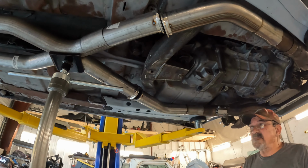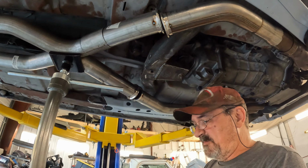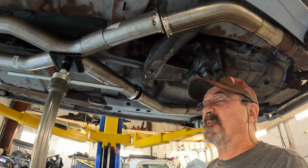All right, let's go ahead and give this a try. The one thing about a V-band clamp is they're pretty unforgiving about misalignment, but I think, since it was already in the first time, I'm going to be okay. So that one's clamped. That one looks good. Let's see if we can get the clamp on it now. I'm going to want the clamp to go this way. So I've got to pull it out, slide it over, come back here, get back in there.